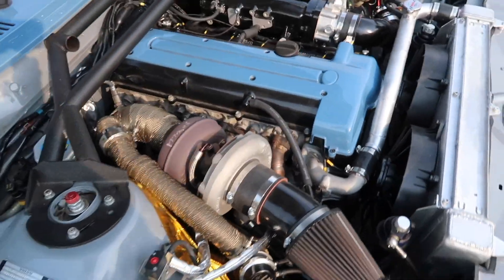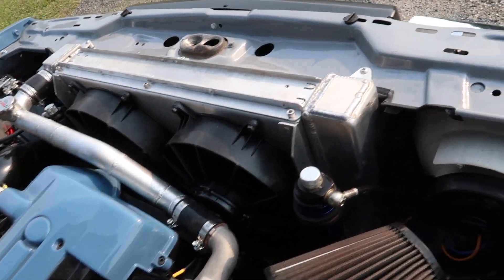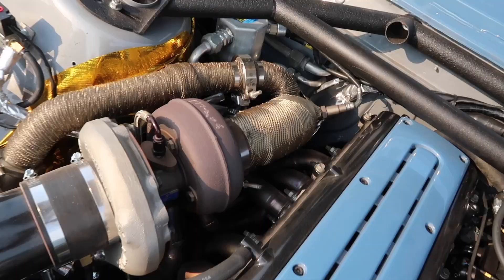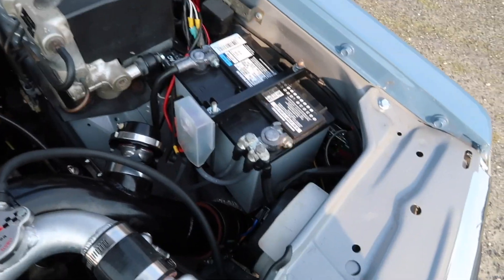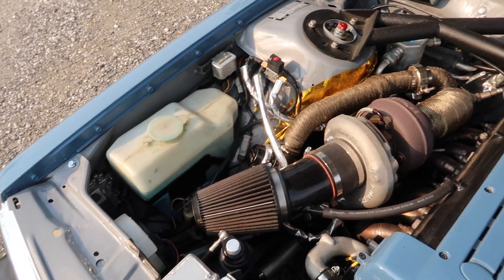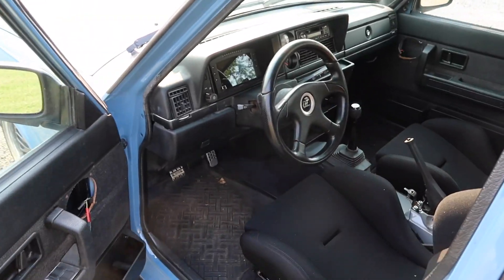Things just barely fitting in it was certainly the theme for this build. It's a pretty jam-packed engine bay even with the engine stuffed as far back as we could possibly get it. 2JZs run inherently hot, so we fit as much radiator as we could — we even modified it to be a triple pass and got two of the biggest, most powerful Spal fans we could fit on here. Of course most everything was custom made: the downpipe, intercooler piping, and all of the plumbing — whether for the fuel system, cooling system, or power steering system. We had room for a small Miata battery up front in the factory location.